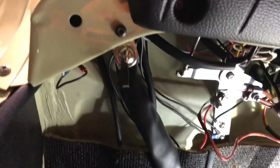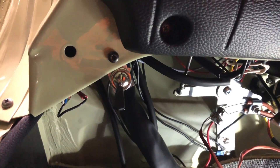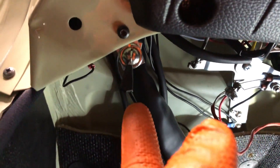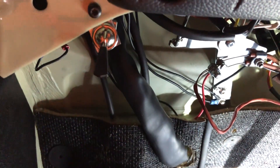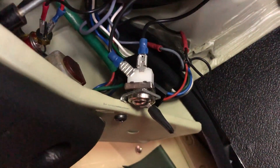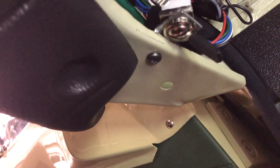There's a hole on the left side available for the map switch — a lot of these cars, left-hand and right-hand drive, have it there. This is a half-inch hole for the switch. The switch I'm using here is an overdrive switch from the P1800, also sold as a fog light switch. It's got a nice feel to it, but I had to make a bracket for it. The bracket has to have a bend in it. I also didn't want to drill a hole, so I just used an existing screw hole.